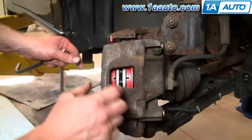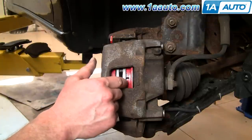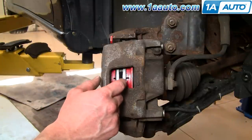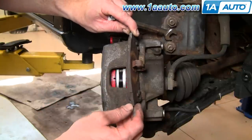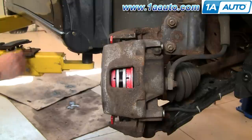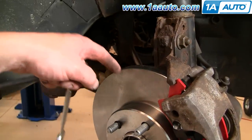Now with the nice new brakes in, you can see everything really well. Here's your caliper, here are your pads in red, and there's your disc in between. You can see the new pads are a good three-eighths to half an inch thick, whereas my worn pads are about half of that. And quite honestly, these pads still have some life left in them — probably another 10,000 to 15,000 miles. If somebody's trying to tell you that you need brakes, this is what you check for: make sure those pads have some good life left. You also want to look at the condition of your rotor.